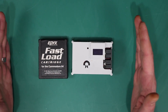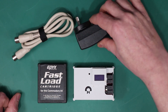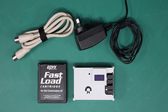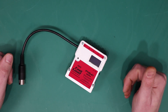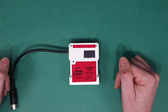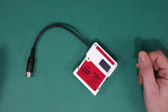Now it's not just a case of having these, because when you think about it you've got these but then you also need for the Pi 1541 an IEC cable and a power supply. So what if we were able to combine all of these into one thing? And here it is — a combined Epyx fast load cartridge and Pi 1541. Because it plugs into the cartridge port, the Pi is able to draw its five volts directly from the Commodore 64, so no power cable, and this just plugs into the IEC port.